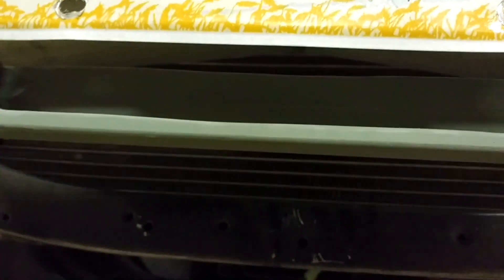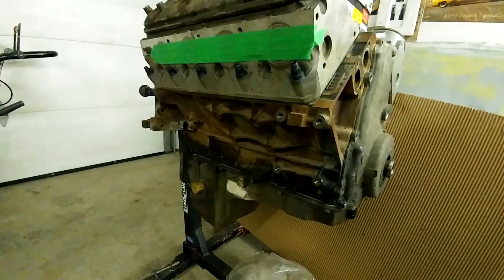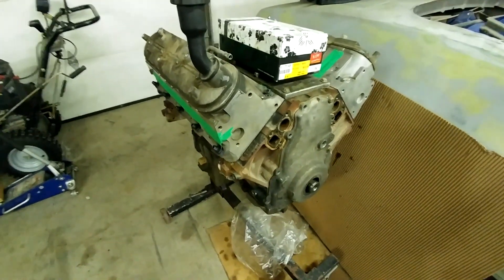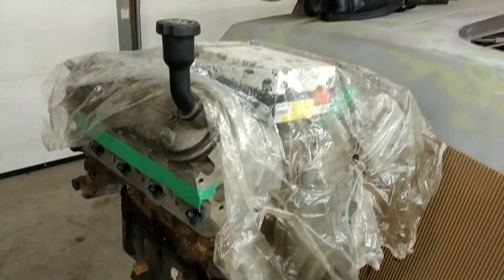One of the cool things Rob did to this bumper - he put this scoop in here to get more air into the rad and intercooler. Clayton called it ricey though, because it's a scoop. Rob's build is definitely a little fancier than mine's going to be - you've kind of got the selection: the Shithorse at the super cheap budget end, mine kind of mid-grade, and then this one - the twin turbo, pretty fancy, probably a thousand horsepower build. As for my motor, I'm planning to go with an S475 1.32 AR, just the cheap one. I figure I can get a genuine Borg Warner unit for about 650 bucks and it'll get me to the horsepower level I'm looking for. Smash that like button! That's all for today - there'll be more videos of this and the Nova build coming up soon, so if you're into this kind of stuff, definitely subscribe, drop a like if you enjoyed, and we'll see you next time.